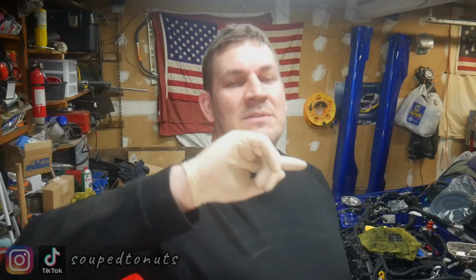Next, a video coming out shortly for you. Today I went and picked up the intercooler piping that was mostly tacked together by my boys at Dynamic Performance. Alan, hi, how you doing? Hey, what's up, bud? All right. I picked up the intercooler pipe that was damaged, that I had them fabricate new pieces for me. To do that, I have to temporarily bolt on the front end, the radiator support, the core support, whatever you want to call it. I don't get bent out of shape here. Then I gotta temporarily bolt up the intercooler, so I know exactly where the intercooler will sit and can see how all the piping lines up.